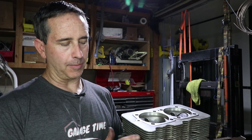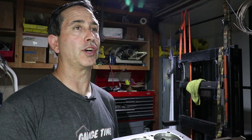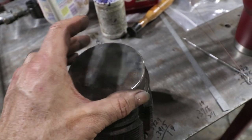Got this head reassembled temporarily. It's not fully cleaned, it's not fully prepped. Now, the conventional way to bench test heads is to use vacuum, and you typically just suck on either the exhaust port or the intake port and you measure the pressure. I have a vacuum gauge, but I don't have a vacuum pump that's really the right level to get any meaningful results. So what I thought I would do is, I do have a leak down tester, and that's a more appreciated, more diagnostic, kind of understood tool to measure the condition of an engine.